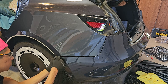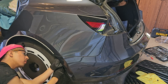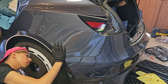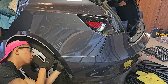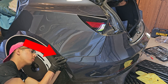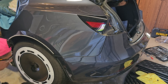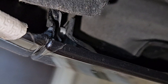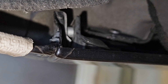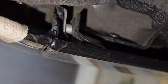Next, put the side back on. Make sure it's all clipped into place and the metal clip that came off — the part with the bit protruding out — needs to be facing downwards. When you're clipping it on, clip it on the edge of the rear fender, not on the bumper part. Clip it on the body part that stayed on the car this entire install, with the little nub facing down, and then put the T25 bit in. Screw that in and then secure the clips holding in the wheel liner. It should look like that, where you've got the kind of nubby bit sticking below, so it separates them.